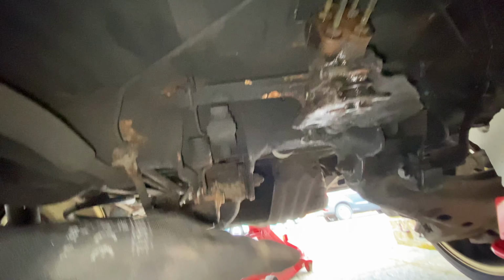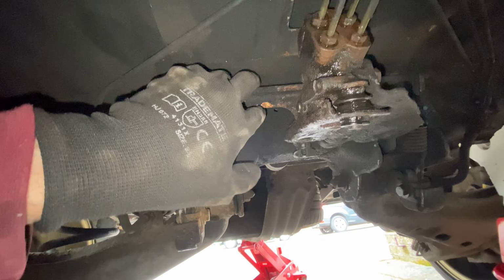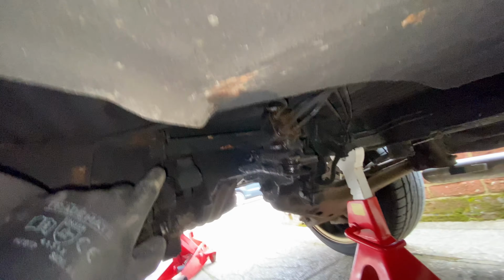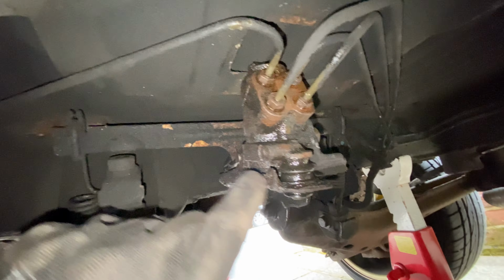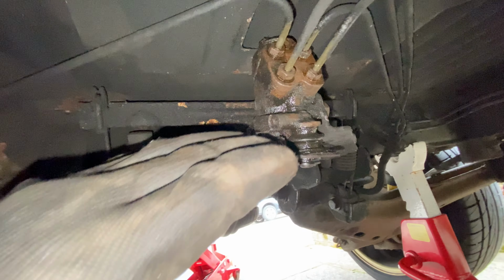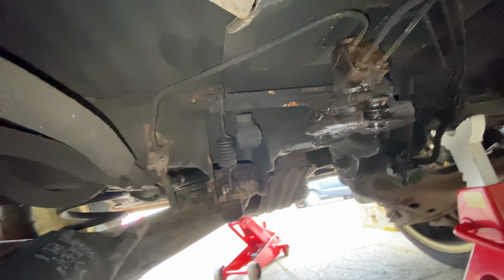But now it's jacked up into the air, you can see the actual springs and the whole unit around it is all now released off. Oh, it's very windy under here as well. But now we've released it, this has actually closed the valve to its set position, which will reduce the amount of brake pressure applied to the rear brakes.